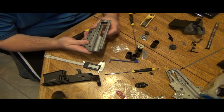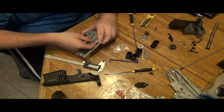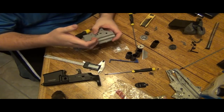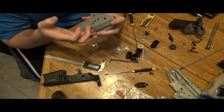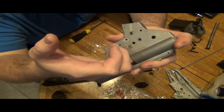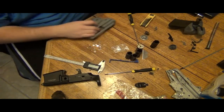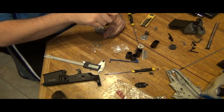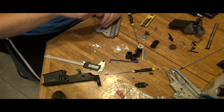Gear still spins without resistance. Is there any up and down movement? You can hear it. It's very little up and down movement. We're going to be messing with 0.1 right now, or even less than that. As long as you can see it, remember the rule, if you can see it, it's not tight and it will spin no problem. So we're going to go ahead and untighten this, and try to get .1 underneath there.